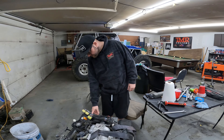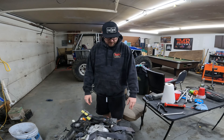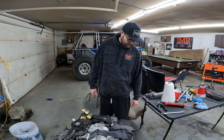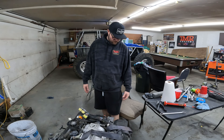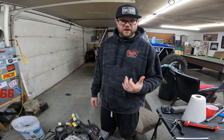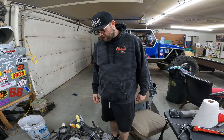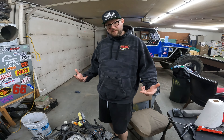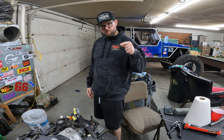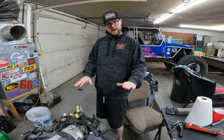The last tag I see for a timing belt was done at 92,000 miles, so I'm gonna pop these covers off and take a look to see how the belt looks — see if it's worn at all. If it's worn, you can see the teeth on the outside of the belt and it's time to replace it. I've been told I'm not a mechanic, so don't take any of my advice as gospel — not a mechanic by trade.